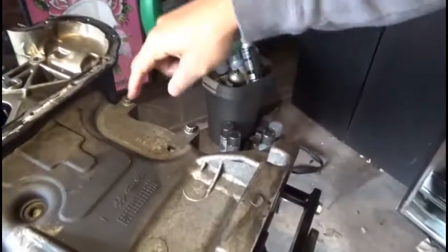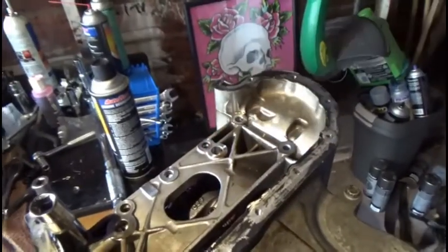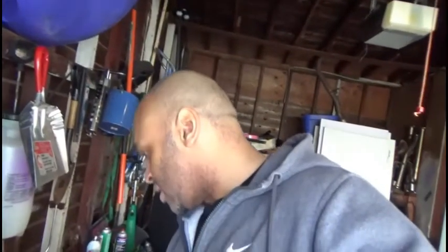As you can see, I hand-tightened these bolts down here, but there's a problem — I'm missing a bolt for one of these holes. I know I had them all when I took the thing apart. My garage isn't messy per se, but now I'm in search of a bolt. Make sure you label your bolts and have them in a bag if you're going to reuse them. I'm just going to tighten these down for now, find that bolt, and then torque them all down properly.